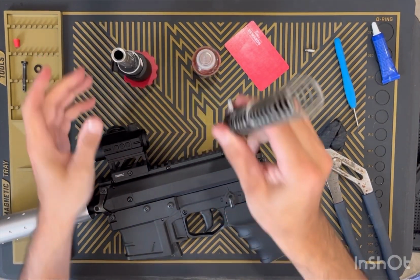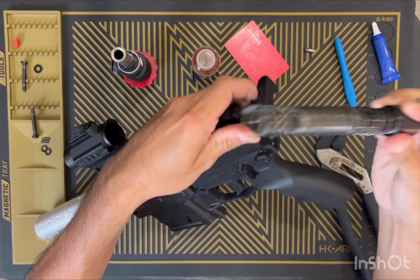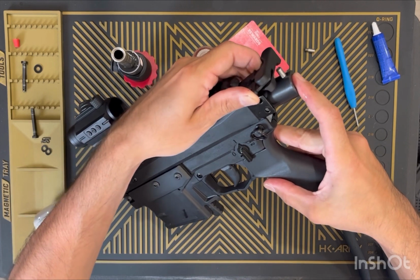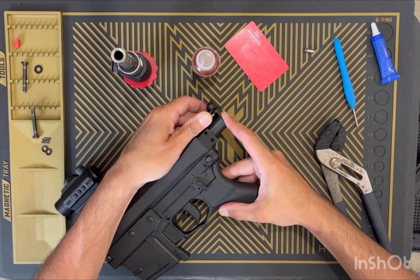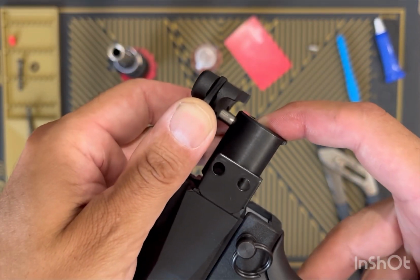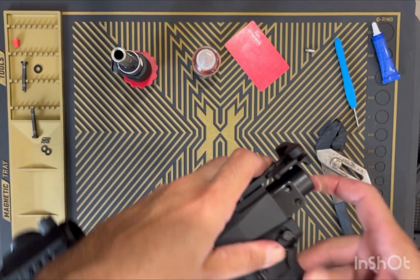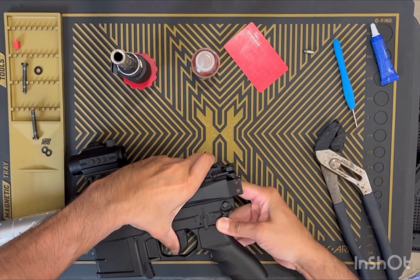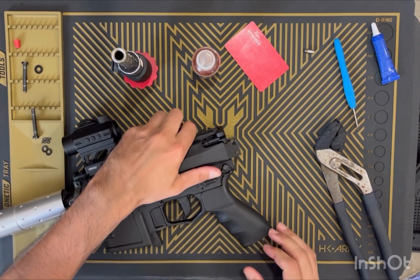And it's actually easier with the BRH, like I said, I remembered from when I put this in the first time. Take your bolt and your spring, pull your BRH back and pull down on your bolt until it tucks in. You can see how it just kind of fell in that little groove there. And once it's in, they can all go back together. There we go.